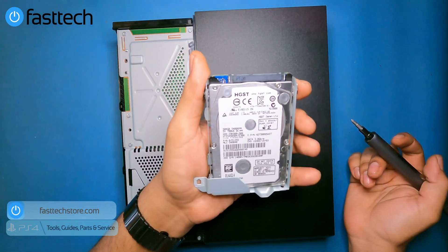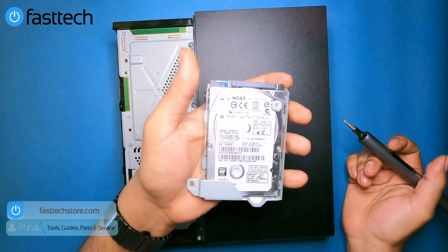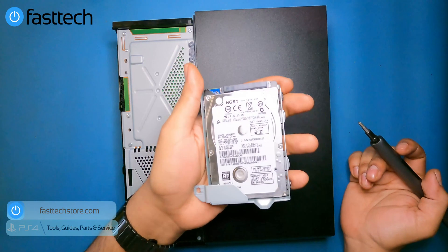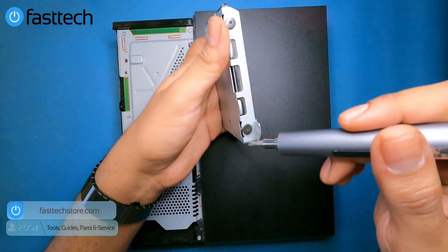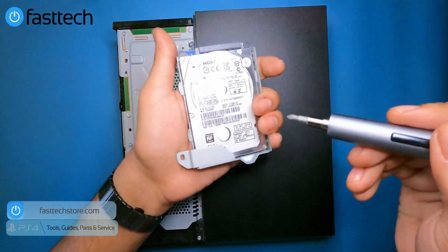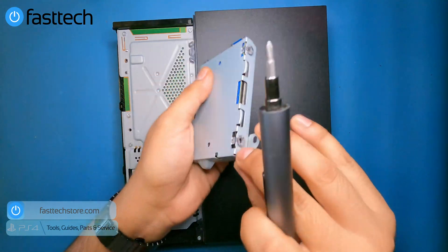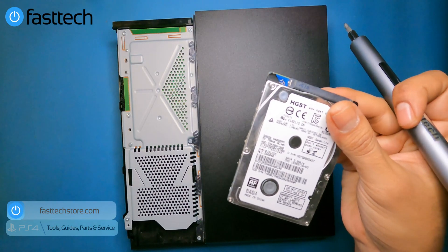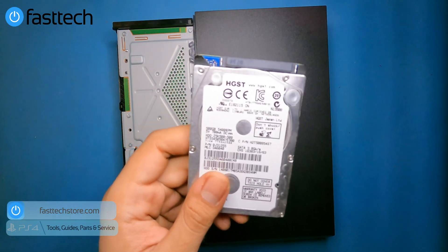You can also connect the hard drive to a PC through a USB-to-SATA connector and do a sector test to check if it's broken. If you get bad sectors, you need a new hard drive — we sell these on our website. To put a new hard drive in, you need to remove the enclosure, which has four Phillips screws. Once removed, the hard drive comes out. That's a 500GB HGST drive — we sell 500GB, 1TB, and SSDs as well.